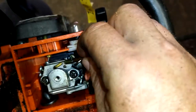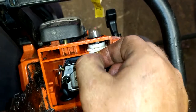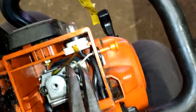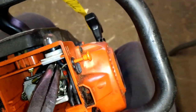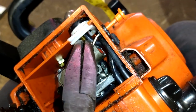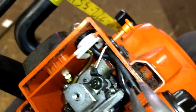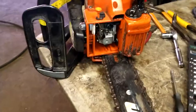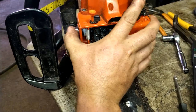I found that pulling the choke arm out gave me a little more space to get that in there. We're going to drop the old line and stab it back onto the carburetor. Most of the time these are still very good and work better than a new one — some of the new material is just cheaper Chinese stuff. We're going to get that on the small nipple in there.